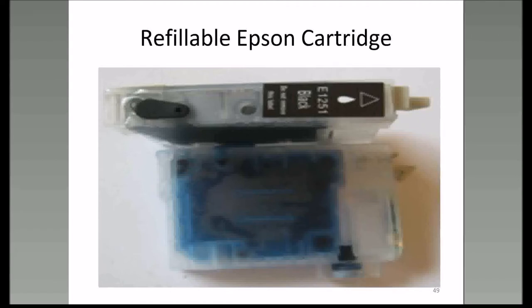This is what the refillable Epson cartridge looks like that I have in my Workforce 500. As you can see, it's translucent. When I go to refill this cartridge, I can hold it up to the light and see how much ink I have before I start refilling and see how much I have when I'm finishing. These Epson cartridges have the printhead in the printer. When you set this cartridge into its seated receptacle, there's a plunger that opens it up so the ink can flow down to the printhead.